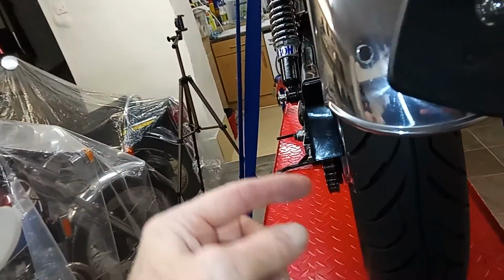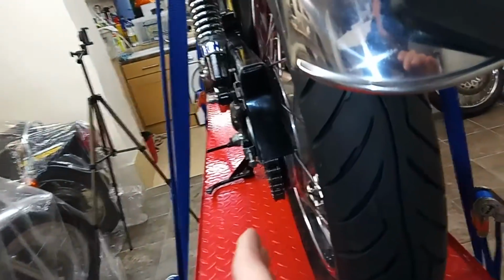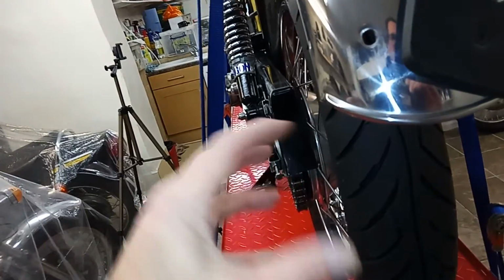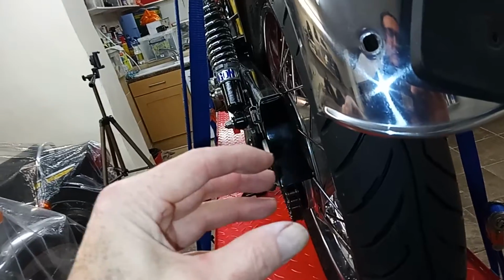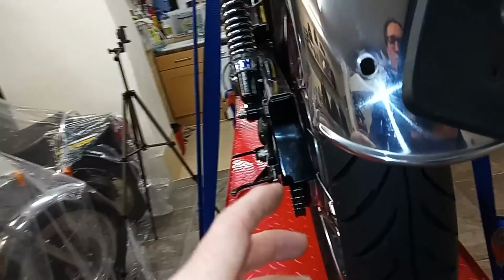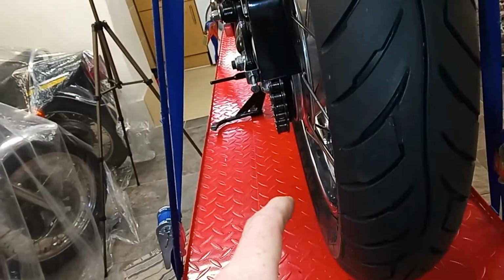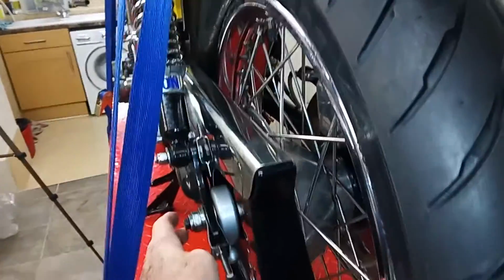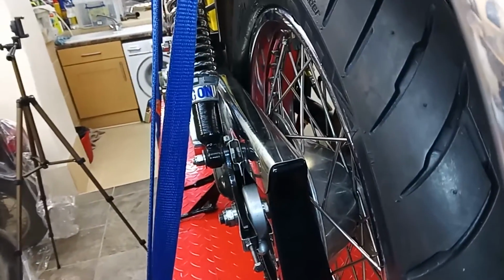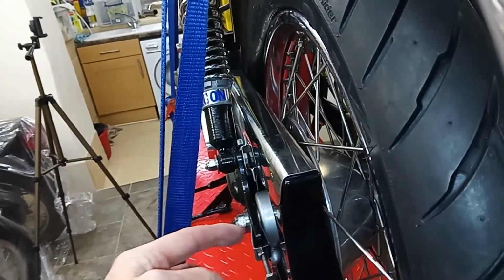It just simply couldn't. And that's why this plate, I did it up and said the vanes didn't seem to be flat, because when you tightened up that peg screw, it hit the outside of the bearing, couldn't go any further, but it needed to be in further. So what I did was, oh yeah, because then what happens is there's like a spigot on this side of the wheel spindle that goes against that inner race as well. So that pushes on the inner race from this side.